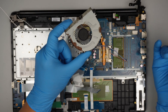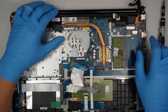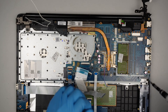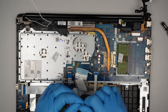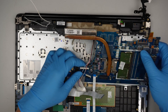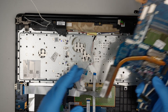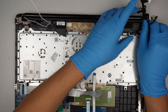This CPU fan needs to be changed — it's all rusted and corroded. Let's start removing the motherboard. There's one screw here holding down the motherboard, and one more on the top bottom right — two screws total. And the entire motherboard will just come right off. That model number is likely what you'd use for a motherboard replacement. And here comes the DC jack.